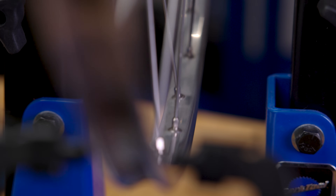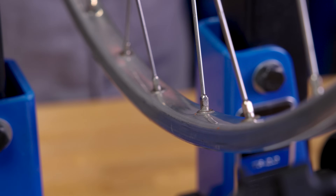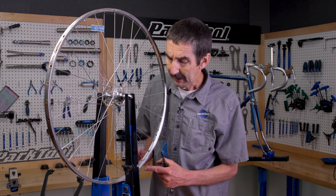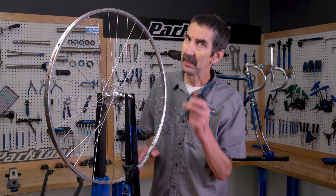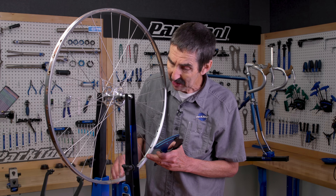There is something else, something more subtle. It's easier to see when the rim is polished. The spokes are pulling at each rim eyelet. But note, this square-shaped rim has deformed a bit — see it here, mostly on the drive side. Potentially that can mean the spokes are too tight and are pulling and deforming at each eyelet. But this is where the TM1 is handy. This wheel is tight, not overly tight, and with these light rims in that shape, you're going to get some of that.